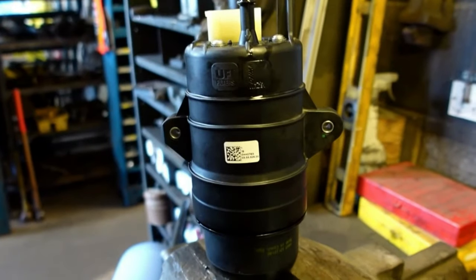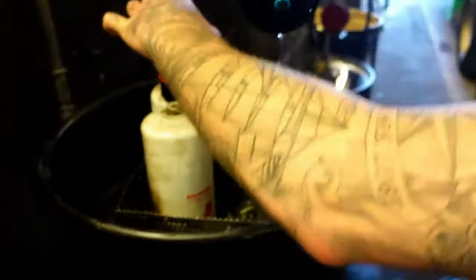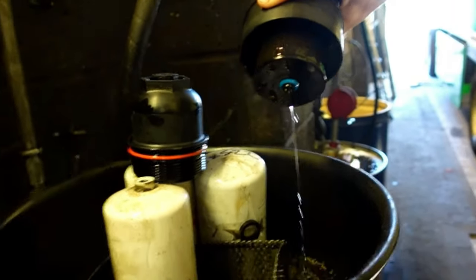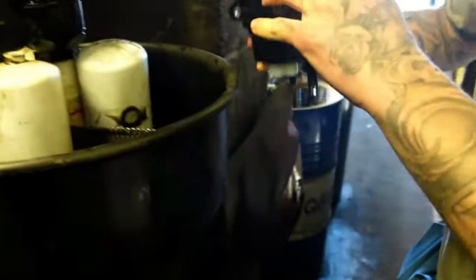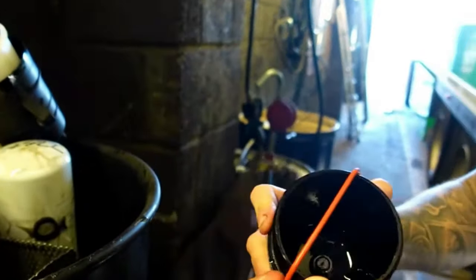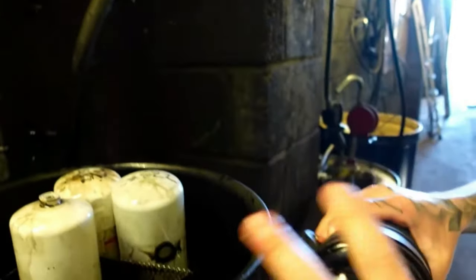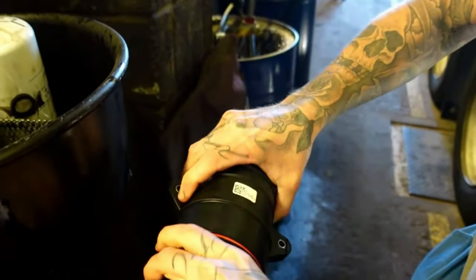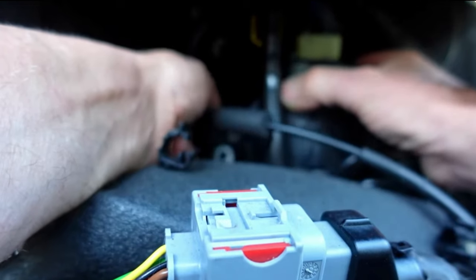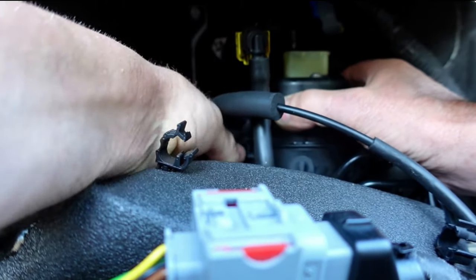The special tool I've got is no bloody good, so I still needed to get a vice to undo it. Here we go. Just drain the excess diesel there. There's the filter - that looks pretty black actually, is that black? So we are just popping the new filter in and all we have left is a little tiny O-ring - we'll discard the old one and put the new one on the bottom of there. Absolutely perfect. I've just spun it around - there's Mopar on the front of there, so that needs to be facing outwards. There's the little bracket for the fuel line.